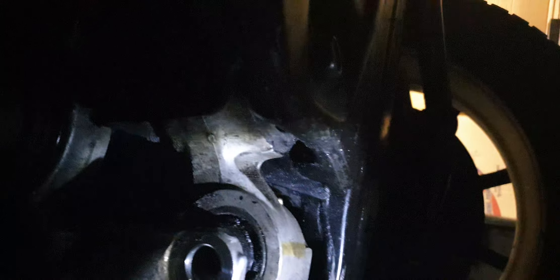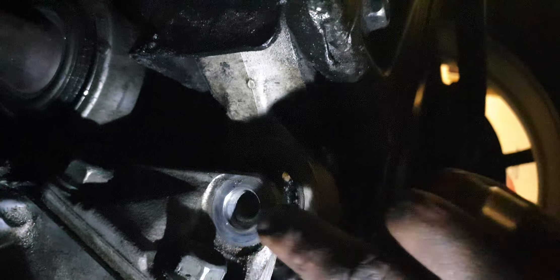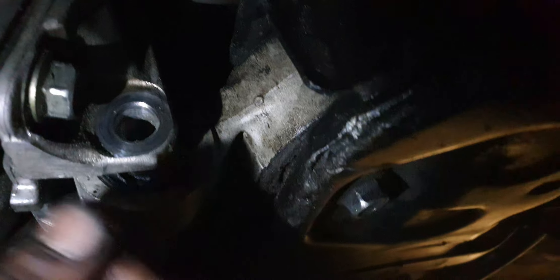Why I haven't removed any other parts — as you can see, if you remove the bolt from the engine mount, this part can go up and down. So once you remove the sump, it will just drop down, and the engine mount will slide up and out. This is just the bracket — once you slide it up and out, it's pretty much straightforward.